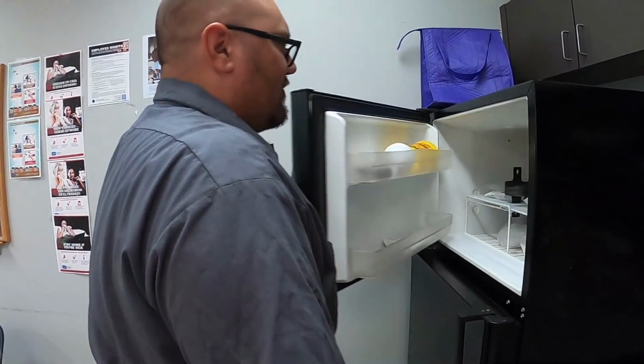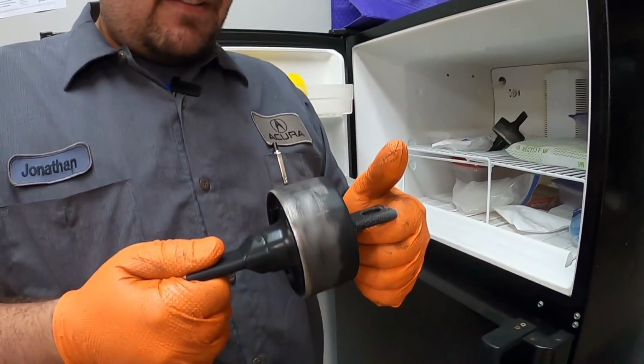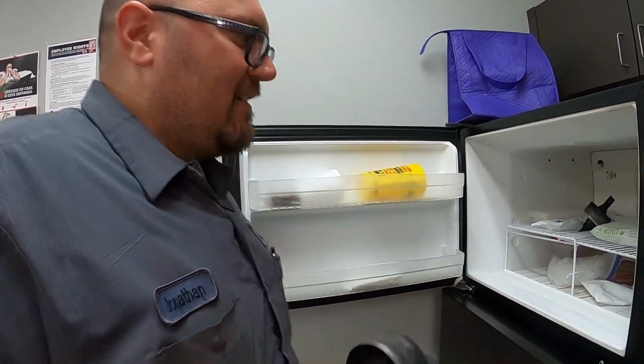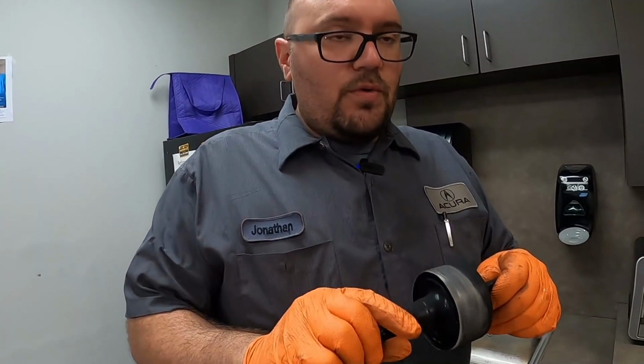Whatever. So here we go. We got the compliance bushings in here. Nice and frosty. I bet if you stick your tongue to that, it'll stick. Don't do that. We're gonna do one at a time so it stays cold. So hopefully this coolness has shrunk the circumference just a little bit to get it to go in a little easier. If it didn't, oh well, we're still in the same boat. I like to think it helps.